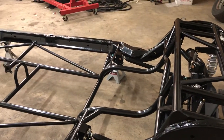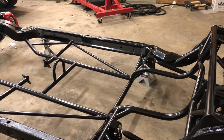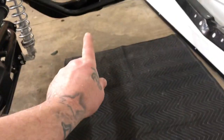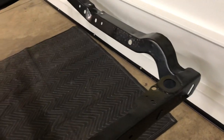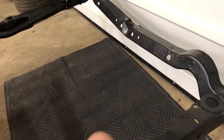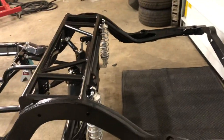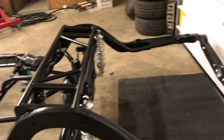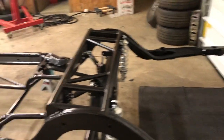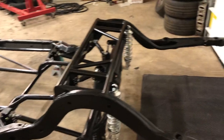The underneath of the body is still supposed to be getting painted. We had the back three bolts that were broke off in the frame for the body — I believe it was those two on that side and the one here. We were able to weld a nut to them, which heated them up, and then use the impact to get them to come out. Now all the bolt holes are good on the body side for the frame to attach back on. We have brand new bushings and brand new bolts to put it back on there.